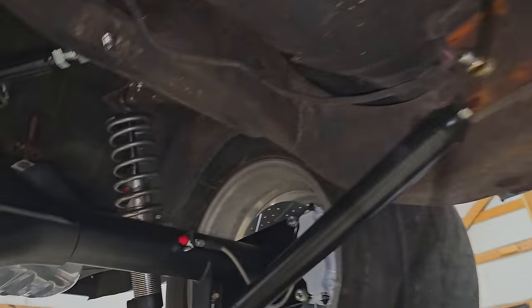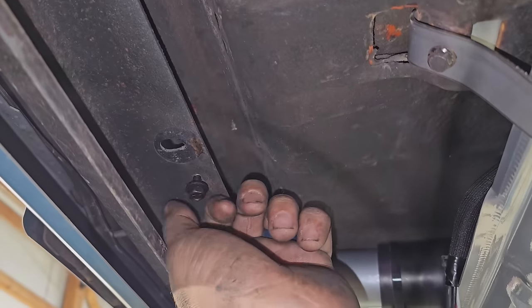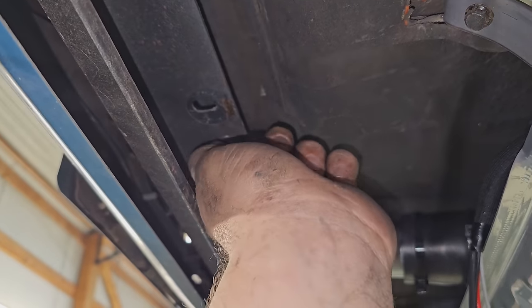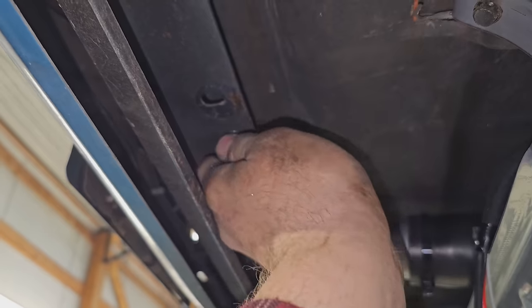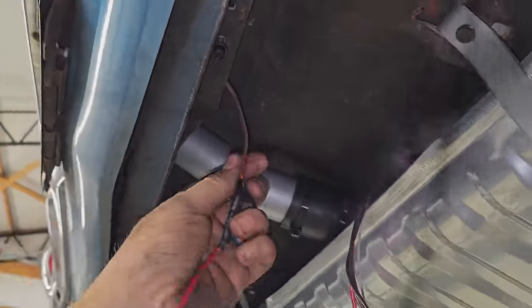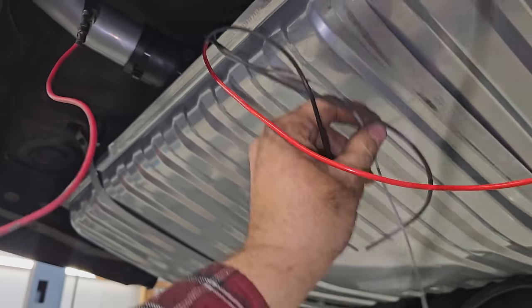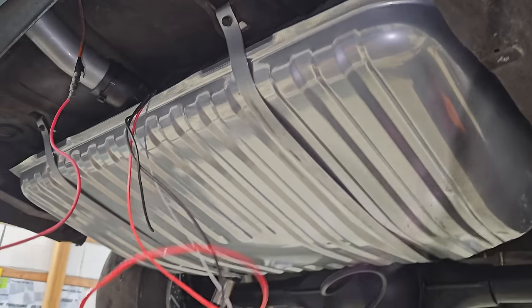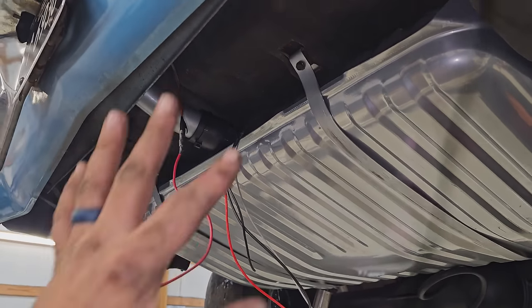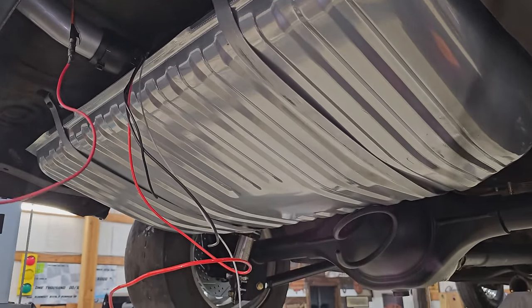Right now I'm working on the wiring. Back here, gonna get this done while it's in my teeth. So I drilled and tapped this guy, that's going to be our ground. I'm going to pull this out and clean the metal up just a little bit more, and then boop, nice short clean ground. This right here is going to get a plug that'll plug into that. This is going to get coiled up and stored for later. That'll be the fuel gauge that'll never get put in, but then this will be all buttoned down. We should actually be able to test fire the fuel pump.